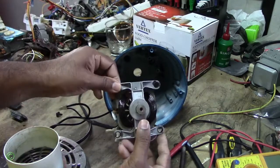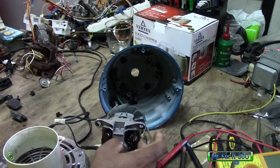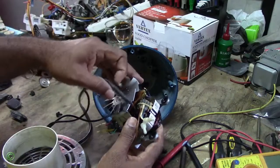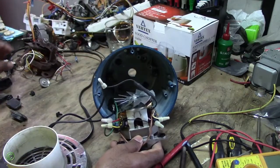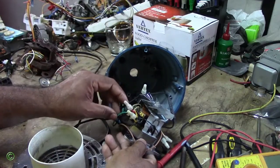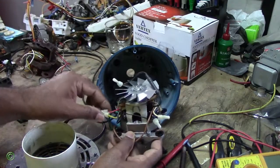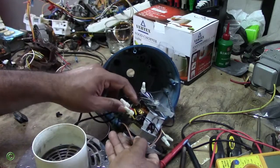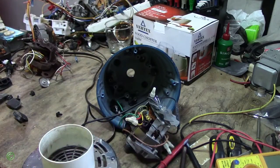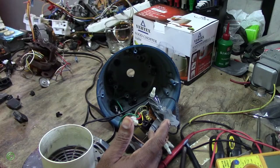That was the main reason why it didn't gain enough speed across all three levels and it smelled bad — because the field winding is gone. In order to fix this, you have to replace the whole field winding. Make sure you get the correct field winding with the same number of wires. Sometimes you might get one with four wires, sometimes with eight wires. This one has eight wires. It's also overheating, so to fix this we need to change the field winding. I'll put it back together and get back to you.